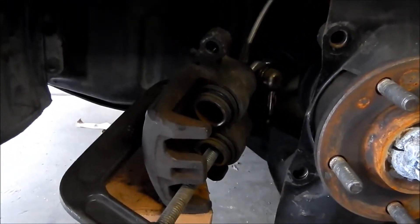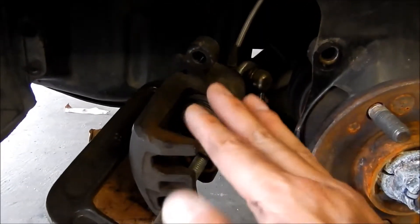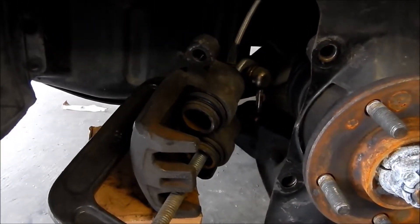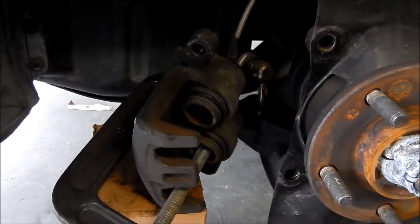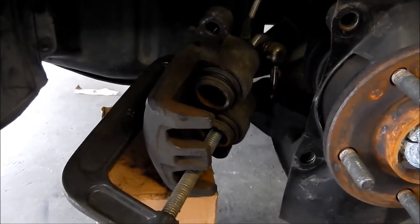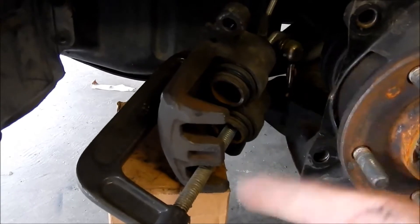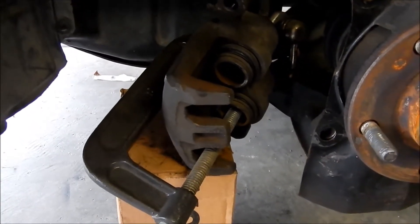What I'm thinking is that one of these pistons is coming out more easily than the other, and it's pushing the pads cockeyed, you know — they're not balanced. So hopefully me exercising it like that helped it move in and out more easily. Yeah, that's the only thing I could think of as the problem. So what I think I'm going to do is push both of the pistons back in, and then do the same thing again and see how easily they move out.